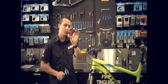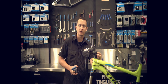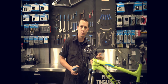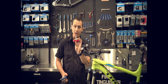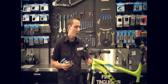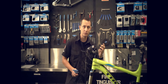If you also have access to a torque wrench, these are quite handy as some of the bolts on bikes require them to be set pretty accurately to the torque. Over-torquing could crush a carbon steer. Under-torquing would mean that the handlebars might move under load or under ride. So a very handy tool to have is a torque wrench. This one is rated to five newton meters which is what this stem is telling me I should tighten to.